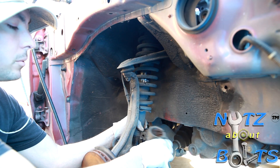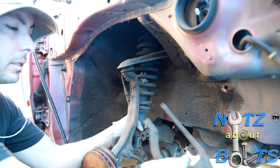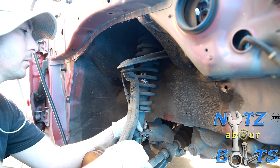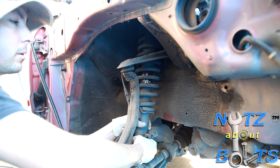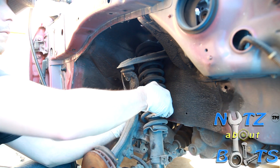To clear some room, I'm going to go ahead and take the fork, pull it up and over the axle, and then push the brake line to the other side so I can drop the assembly and pull it forward.